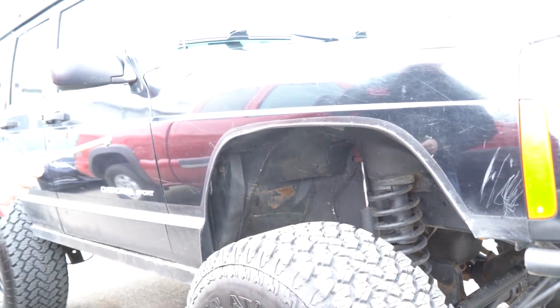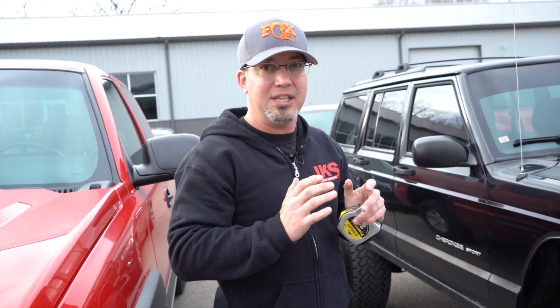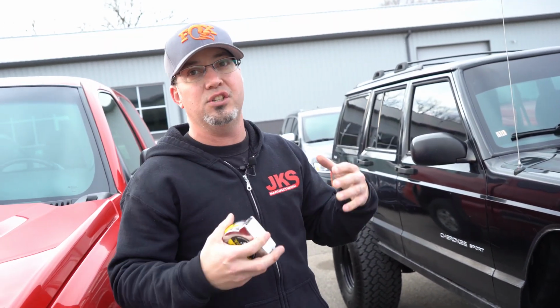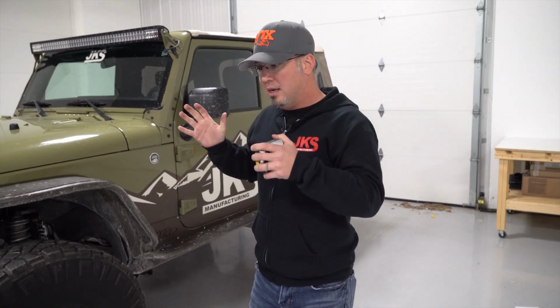So we're majorly looking for something that's going to be the same on both sides of the vehicle. Give or take a 1/16 or an 1/8 of an inch, that's okay. We don't want to give or take a 1/4 of an inch. So let's go check another vehicle. We'll say this is our third and final vehicle, again just getting a good sampling of different situations you might come into with a vehicle that has an adjustable track bar that you need to measure to adjust.